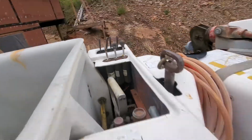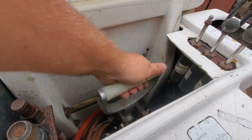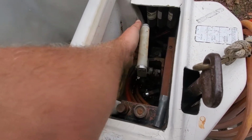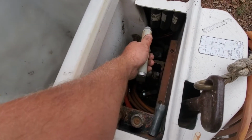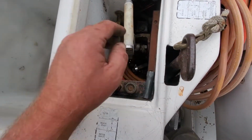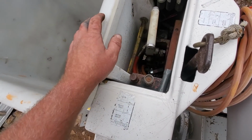The way it works is this lowest lever down here turns on the bucket. Then you're supposed to grab this, giving you full power to the bucket controls. It's run with a galvanized cable through what looks like a motorcycle throttle. Anyways, that cable had rusted solid, and somebody had clearly broken it trying to get it to work. To replace it, they had bolted it together with a 3/8 bolt down here, which simultaneously got in the way of opening the valve and closing the valve. So it was stuck in the middle. At that point, they just ran it.